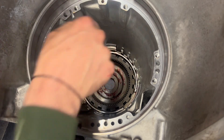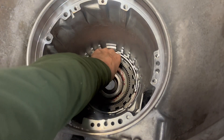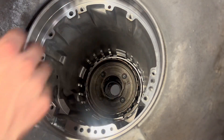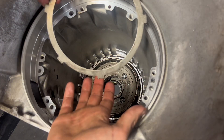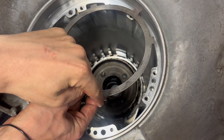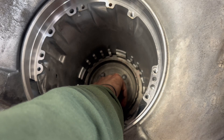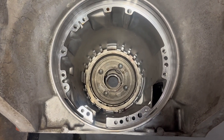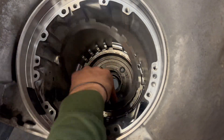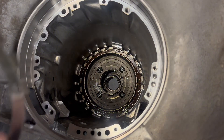This side has a little flange — this face is down. The flange locks into the parking gear, then your planetary. Low reverse clutch pack — this is a wavy. The bottom tooth here, you can see the little notch. That goes down and to the left — you can see where that notch is right there at about six o'clock. Next is your first steel disc and the friction. Go ahead and alternate.